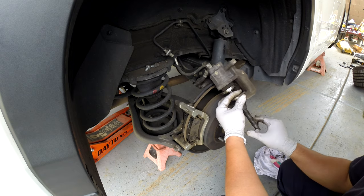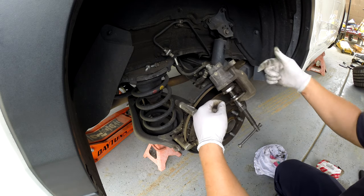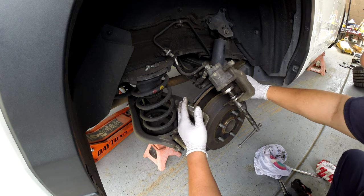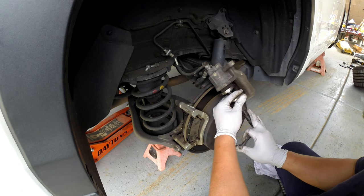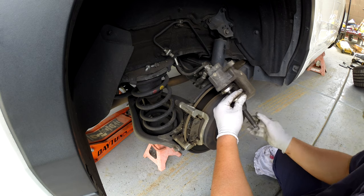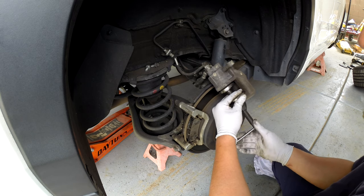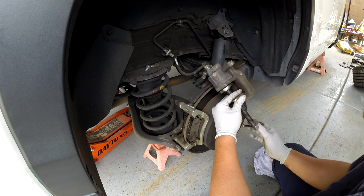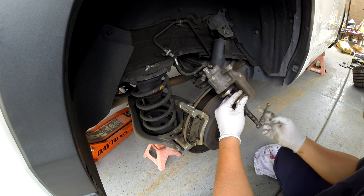If you don't have one of those tools, you can use a screwdriver to pry the piston back, or if you have a vise grip you can use it to press right here — that works too. I showed how to do it on the front wheel. So when you come to a place where you don't have any tools but you need brakes, that's how you do it.